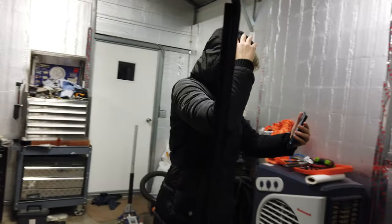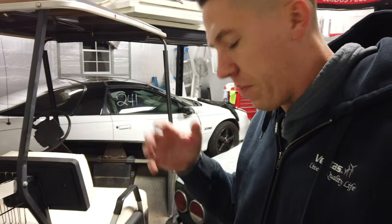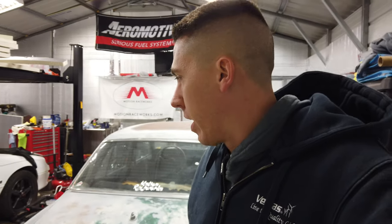April's all bundled up, ready to go for the first ride in the golf cart! I ended up tightening up the carb, so hopefully it won't backfire now. Oh, it's not warm by any means out here. Oh yeah, no problem — this thing rips! It backfires every once in a while, but I don't know why. Well, there it is. Golf cart's running. I think it needs an air filter because it kind of coughs, and I'm pretty sure that's because there's no air filter. Once I put an air filter or put the little intake back on it, I don't think it'll cough.